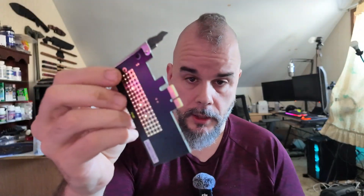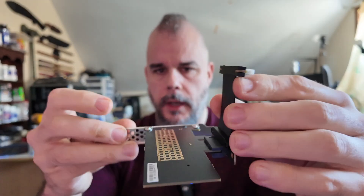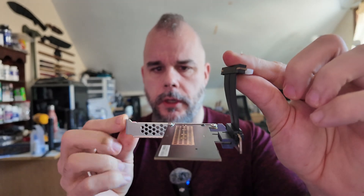I do have other upgrades coming in — a fan controller and some extra fans. But this cable here is not a big one — it's kind of small. Basically you plug it into the board, it dangles down and keeps it away from the video card, and then you plug in the old PCIe 1x card. This should hopefully increase the performance of the SSD and make it run quicker than USB 3.1 speeds.